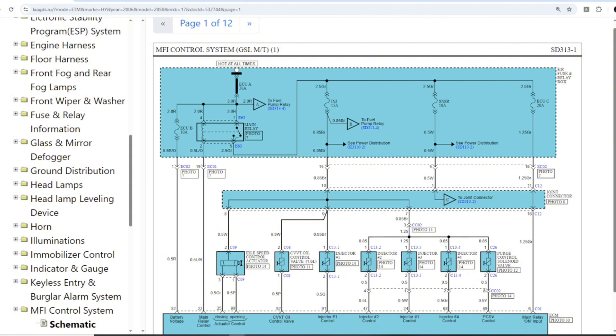In reality, an engine ECU system does not simply work in a ready state. To actually start the engine and keep it running, many more conditions are required — for example, the immobilizer signal, the crankshaft sensor signal, and the camshaft sensor signal. And once the engine has started, the ECU must make sure the engine operates smoothly with no errors, coordinating with many other sensors and auxiliary devices in the vehicle.